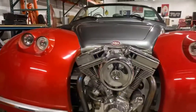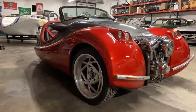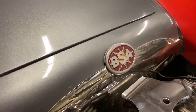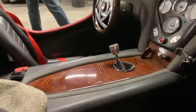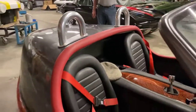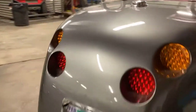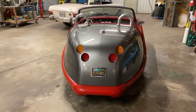It's got a Harley motor — a 100-inch Ultima aftermarket Harley engine. It's a composite body: the lower body and upper body are carbon fiber, and the fenders are fiberglass. It has an aluminum backbone frame, a Borg-Warner T5 gearbox, shaft drive to the back wheel, and a BMW motorcycle trailing arm in the rear. It is fast and very stable — it handles really well. I love the stripe on that one too.